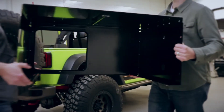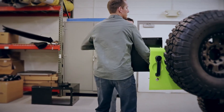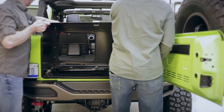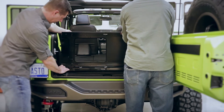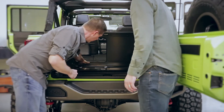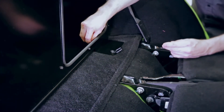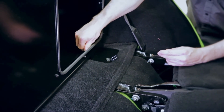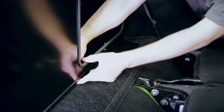Now the bolts are nice and tight, we're going to go ahead and carry this over to the Jeep. This isn't too heavy but it is bulky and awkward, so certainly helpful to have two people. Set this down into place, somewhat align these holes on each side, and we'll begin locking this down by starting with the front bolts up here in the pass-through plate. Now that we've aligned the holes to the front base plate bracket, I'm just going to start finger-tightening these bolts into place — only finger-tight because we have to align the rear bolts to the holes as well.